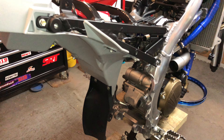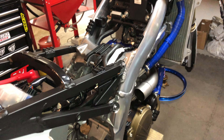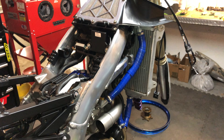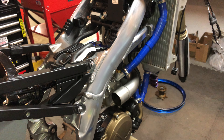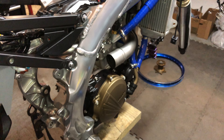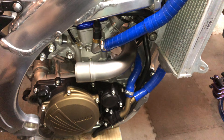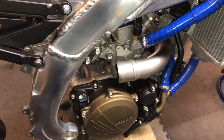We're coming along — I love this black subframe, the thing looks wild. We're going to put a clear vinyl on a couple parts just to protect it. Cerakote is strong, but there's no coating in the world that's 100% bulletproof — it's going to wear out eventually. It'll last a long time, but it will wear. I did powder-coated cases once and wore through it halfway through the season. Cerakote is just a thinner ceramic coating that is very, very durable.